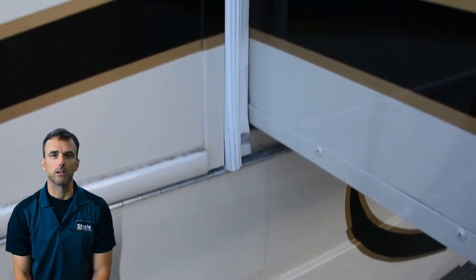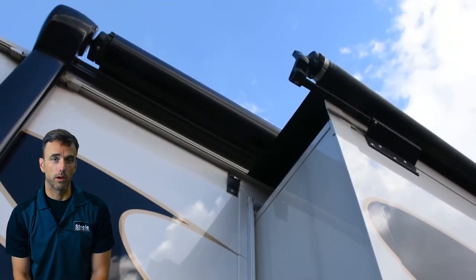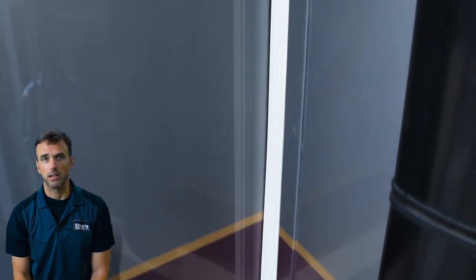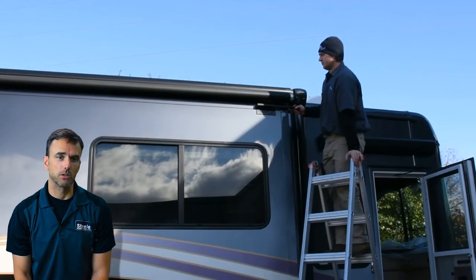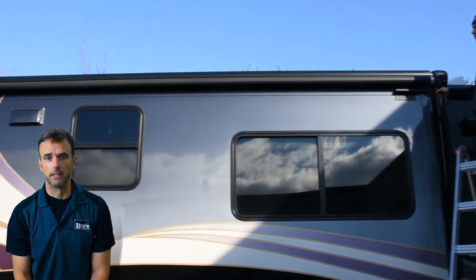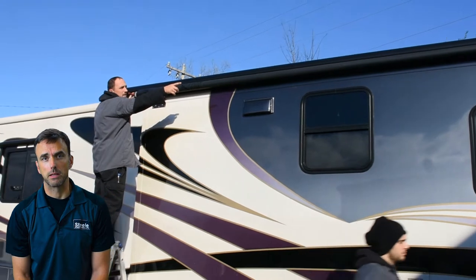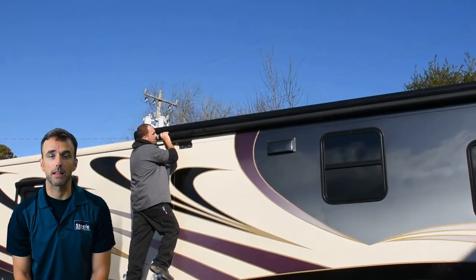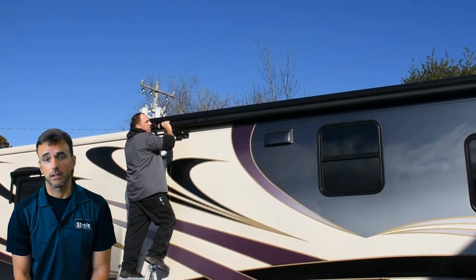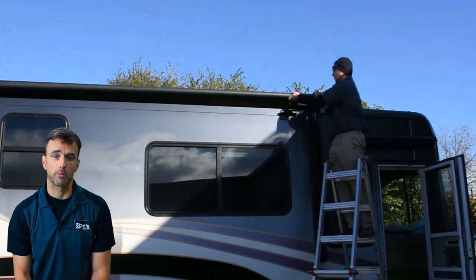What we're doing now is taking a look at the existing seal on this Class A — the exterior slide-out seals. What you're seeing is a foam rubber white extrusion that's been applied using an adhesive, as opposed to a push-on. The problem with this particular slide-out seal was that it was dimensionally incorrect — it was too small of a wiper to effectually complete the job. What you're seeing here is Greg taking the steps to prep the Class A, which entails removal of the slide-out awning that you commonly see on campers with slide-outs.